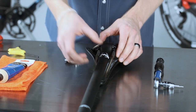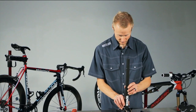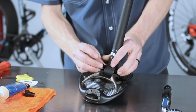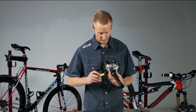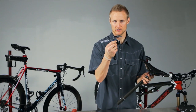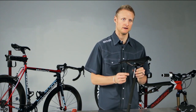From here, it's virtually the same installation as the standard rail saddle. Grease the bolt, grease the wedge — just a light coat. Install one side, then put a light coat of grease on the other wedge and install the other side. This one uses a four millimeter Allen. Thread until they catch, get a little bit of tension, and adjust as needed. Complete the installation by taking your torque wrench — 10 newton meters is a good starting point — and tighten until you hit your torque spec. That's how you install your oversized saddle rails into the Envy Carbon seat post.